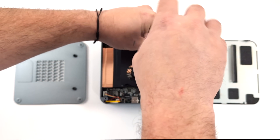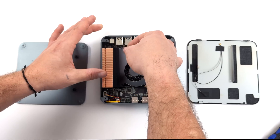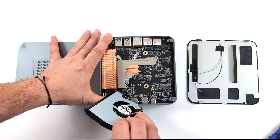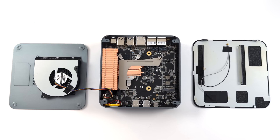I'll let you in on a little secret — you can actually overclock the RAM from the BIOS. This is not recommended by the manufacturer, but that's exactly what we're doing in this video, bringing it up to 7500 megatransfers per second. Initially I was unaware this was utilizing LPDDR5 RAM, and once I pulled it apart I noticed there were no sticks in here — the RAM is actually under the CPU cooler. In conjunction with that much faster RAM, and the fact that we can run this up to 75 watts continuously without worrying about battery life, this makes for a really powerful mini gaming PC.